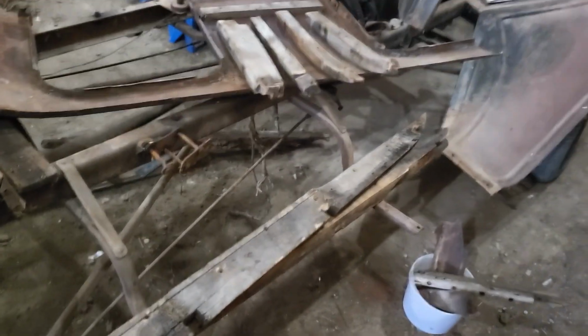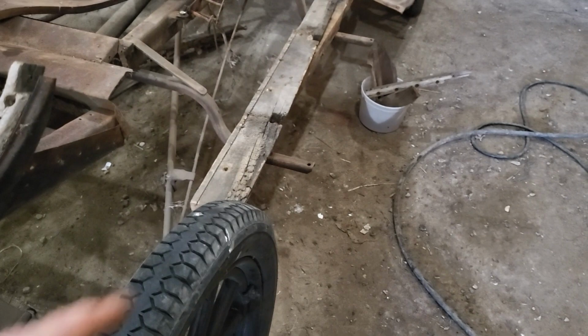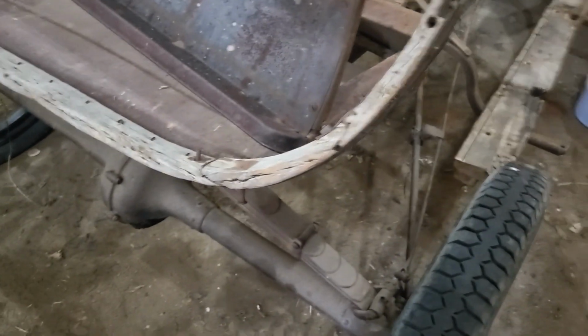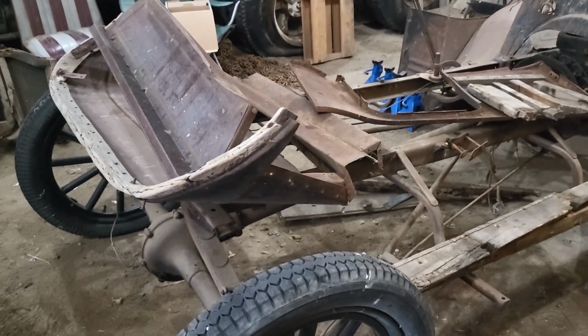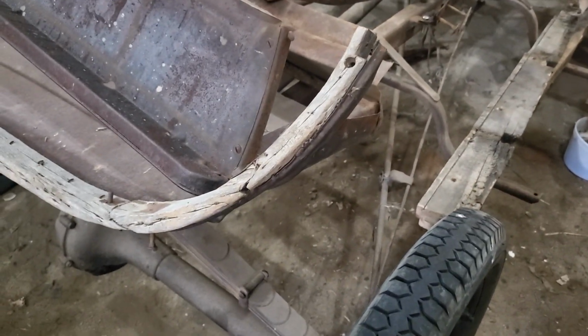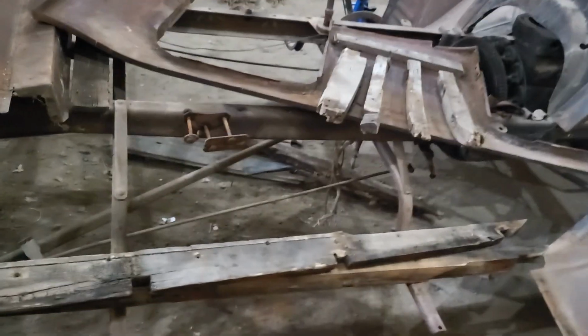In my case, I've cut it here, as you saw me take a hacksaw to the body and chop the back off, because I'm putting a pickup bed on. And I think before I completely fabricate this piece, I'm going to do some measuring, and I might just make a piece long enough to be also the main structure for my pickup bed. Because it will mount back here on the rear body mount, but then it extends back past the back wheels, however far looks right. And I'm just custom making the whole pickup bed out of wood. And so I might as well incorporate the main frame structure of that into this piece as well. And then again, I might just start it here and tuck it up underneath, and then we'll see. I make this all up as I go.